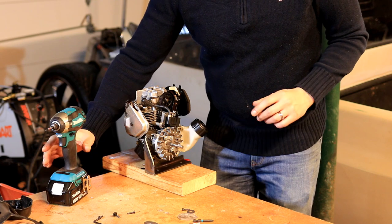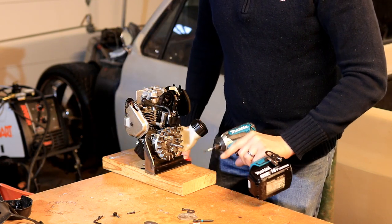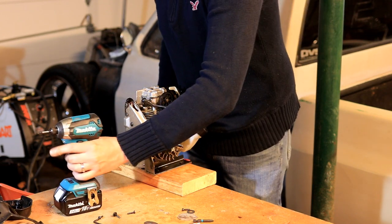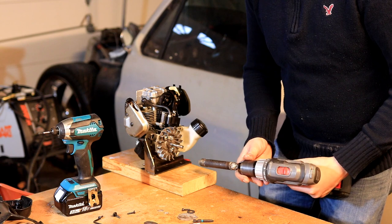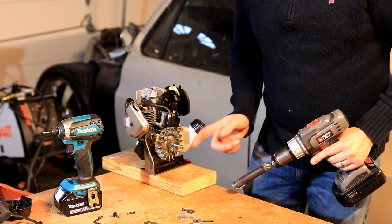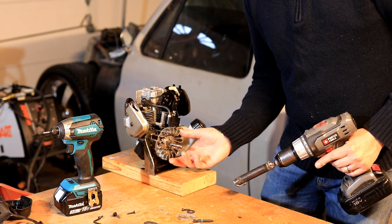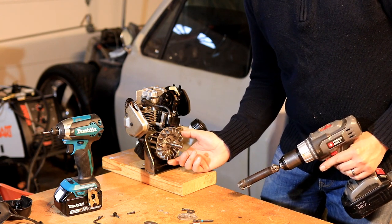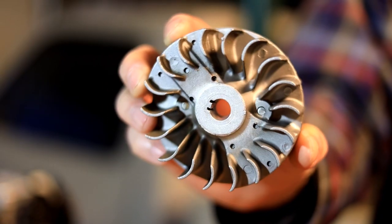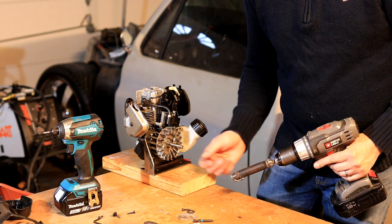Now I learned a pretty good lesson when I was working on this project. I have this Makita cordless impact driver, which is a total beast. I'll put a link to that in the description. It is one of the most awesome little tools that I have. But it was so powerful, and as it was whacking on impact, instead of starting the engine, it actually sheared the little pin that indexes this flywheel to the output shaft or the crankshaft.